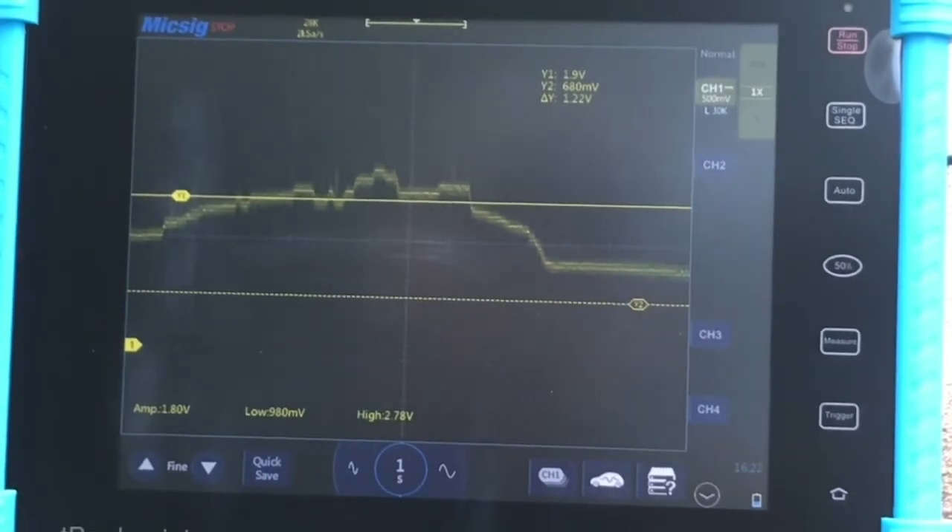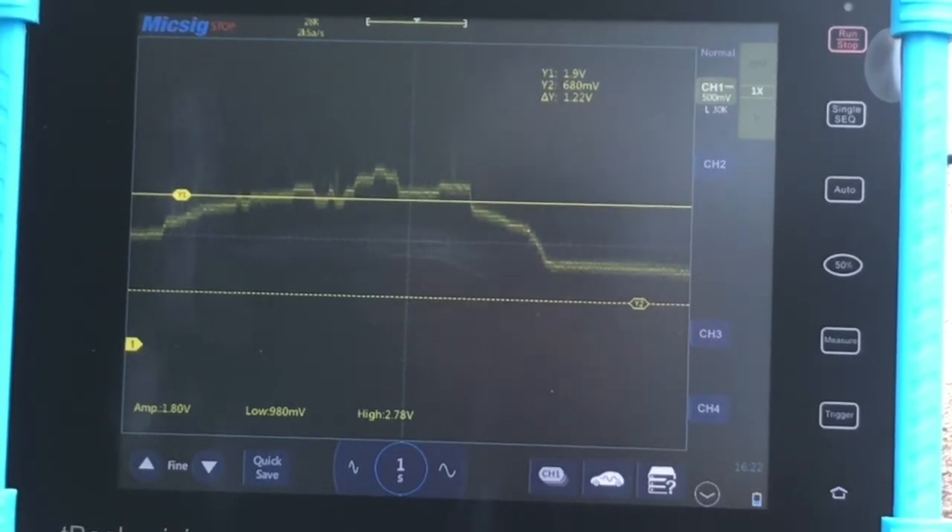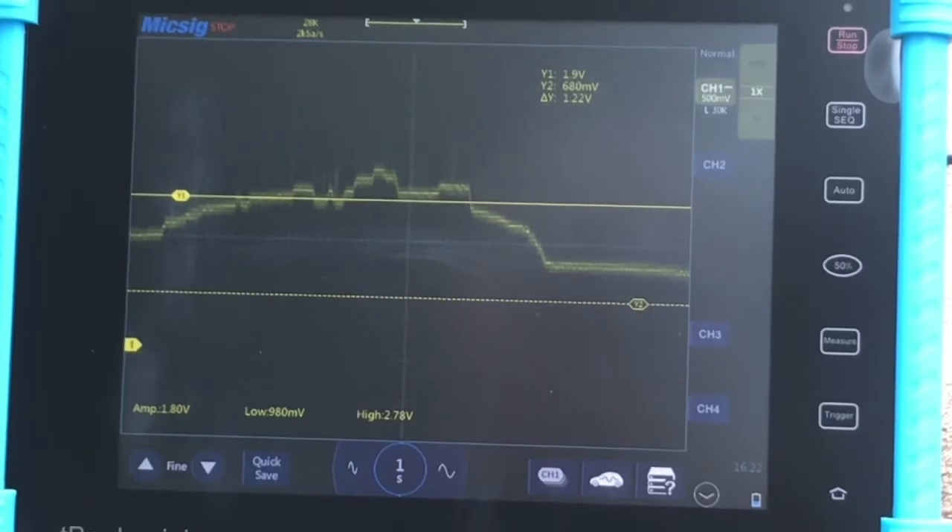So this is a good MAF sensor, which I knew already. I just wanted to make the video since our subscriber Daniel Lopez asked. Remember guys, if you ever get diagnostic trouble codes for sensors, don't rule the sensor out before checking the power, the grounds, and the signal wire.